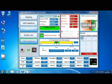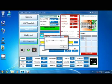The previous sensor, the fan sensor, is reconnected, and I disconnected another one that is in the list. So the Petrol ECU is finding an error. You can see it here by clicking. P0110. I put this error in the list just to make you see how it works.